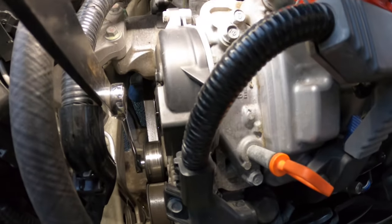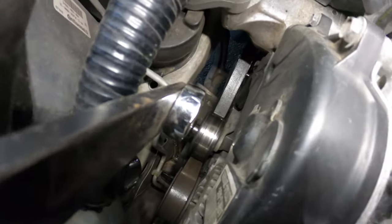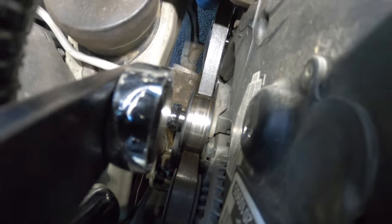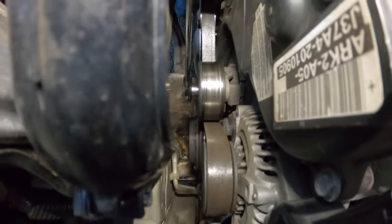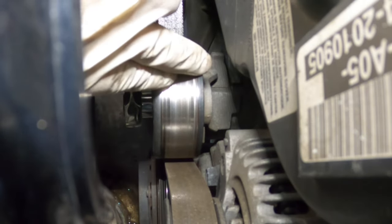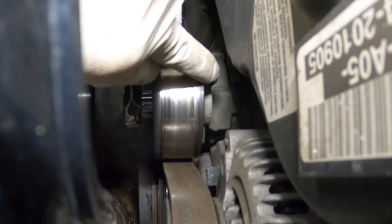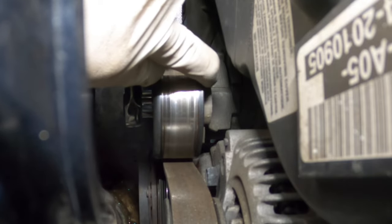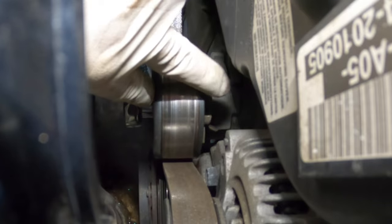While you're putting your drive belt back on or taking it off, it's a good time to check your drive belt pulleys. I just realized mine is worn out. Take the tension off the drive belt and shake the pulley side to side - you can hear it and see with your eyes that it's worn out. So I need a new drive belt tensioner.